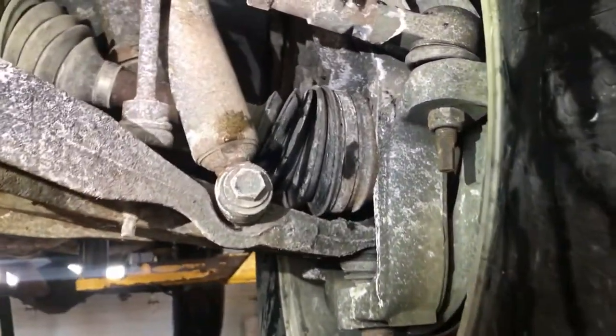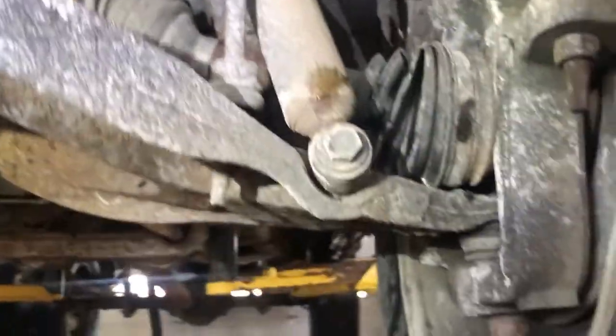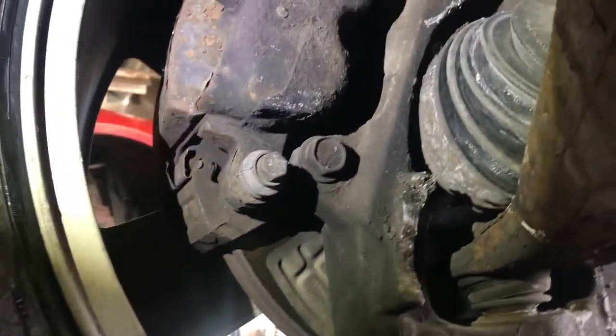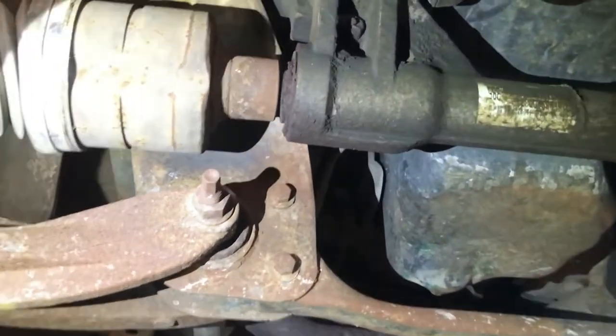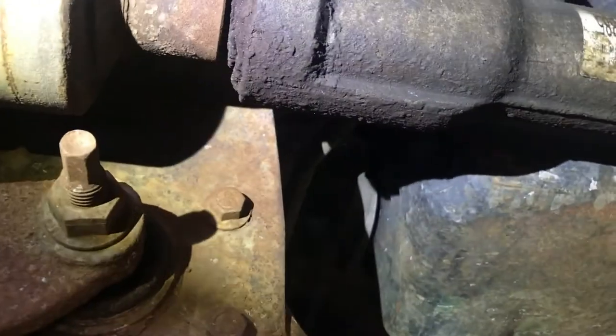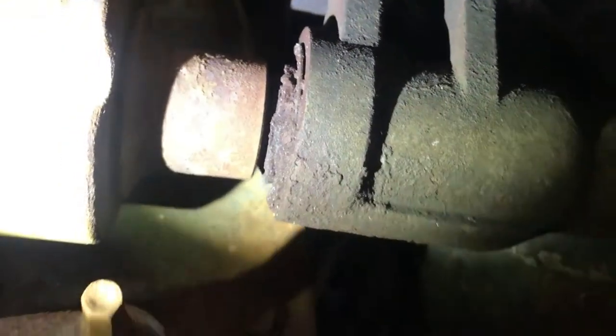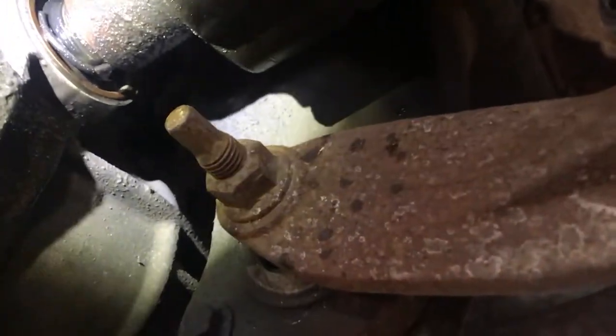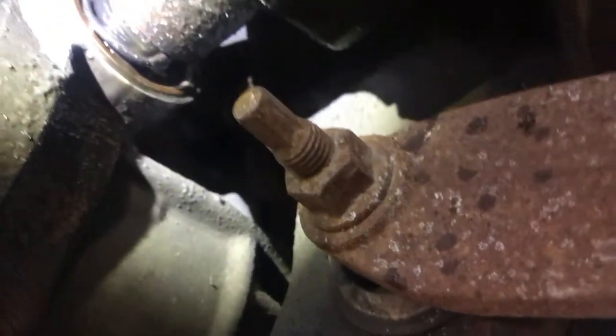Okay, we've got it up and just a quick look around first to see if there's anything obvious, anything out of place. The brake rotor and brake pad look pretty good, so the grinding is not the brakes. And when I look at the actual shaft on this side, you can see it's brown and some very shiny metal came out from the shaft. On the other side, there's fluid coming out and the seal looks kind of destroyed.